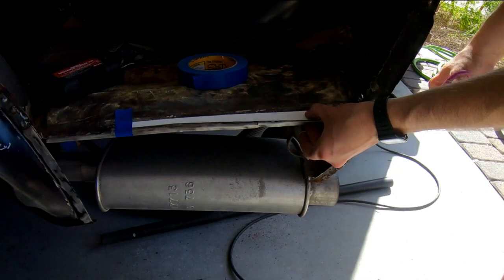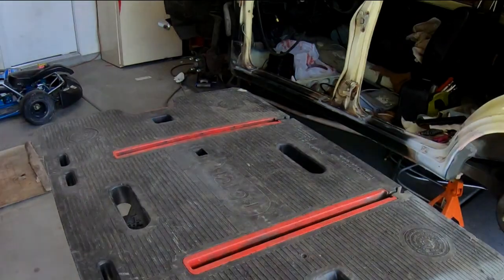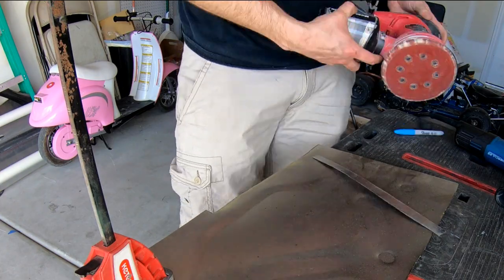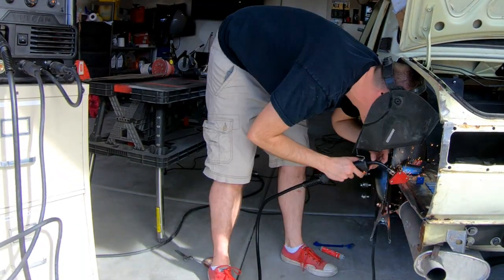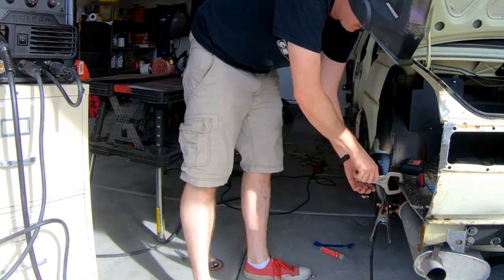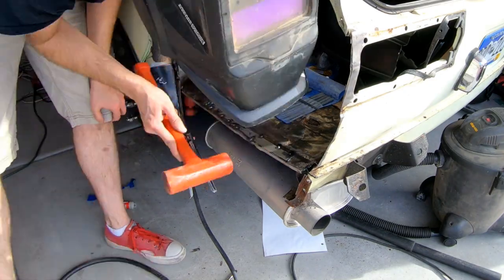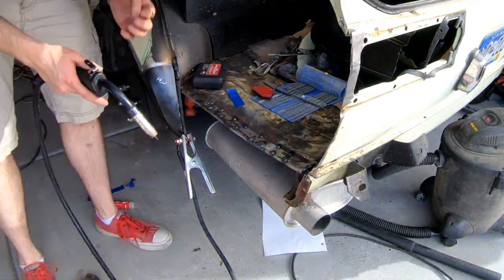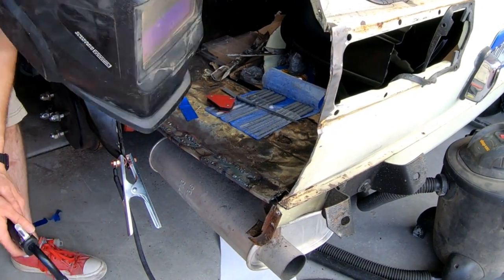Templates from paper served the purpose here pretty well, getting me close enough to use some of the additional floorboard material I had left over from the rear driver-side floorboard. Once I got that laid out and cut with the four-and-a-half-inch angle grinder, I realized I need more clamps. For those wondering, I am using an Omni Pro 220 multi-function welder that I got secondhand from Craigslist. I've really enjoyed using it so far and it's definitely helped my welding, though I am still learning. I'm also using a hammer and dolly set — a new thing for me — just working on getting panels flat.